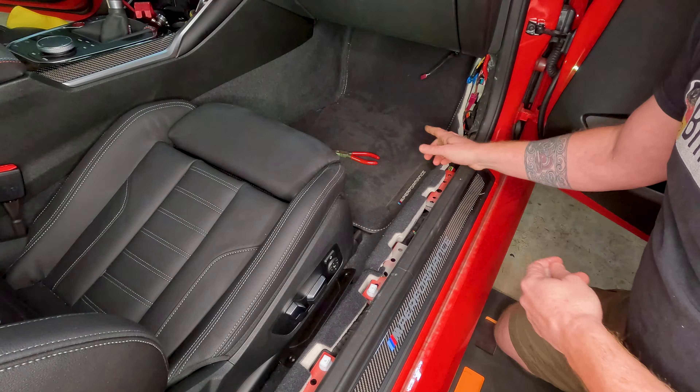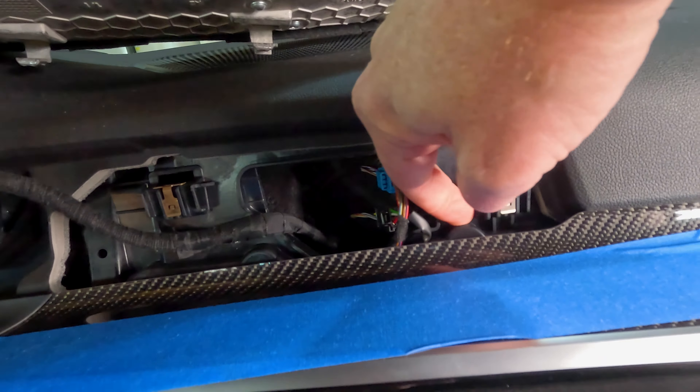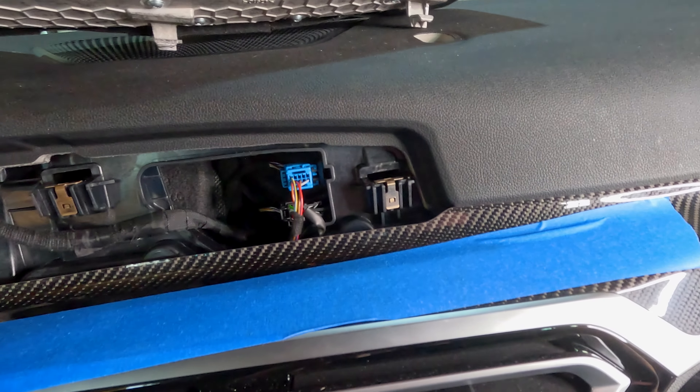Here's an interesting part to explain. I've jammed a flashlight up into the corner so I can see. Looking right down through here — it's hard to show with the camera, but if you put your head there and look down, you can actually see the flashlight shining all the way up through. This is the path the cable is going to take. Take something to fish with — I use a metal hanger, straightened out nice and straight. Feed it in from above down toward your light; when you hit the light, you know you've come out the other side.